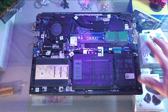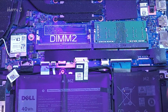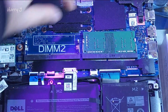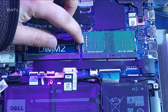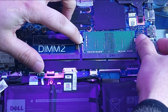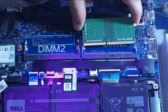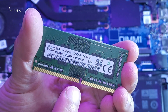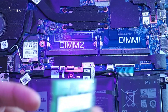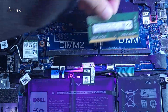Now to replace the RAM — we have the RAM here. You can see the RAM has two clips on two sides; we have to move these clips. I pull one side like this, and both of them together, and the RAM will come out. Taking it out gently — here we go. This is DDR4 RAM, so you have to get a new RAM that is similar. You have two RAM slots here, so you can install two RAM sticks the same way.